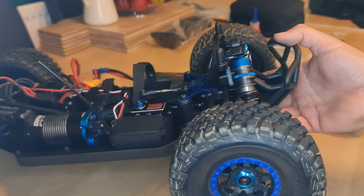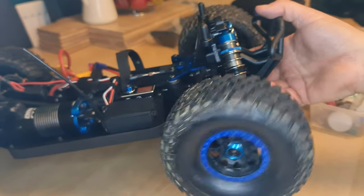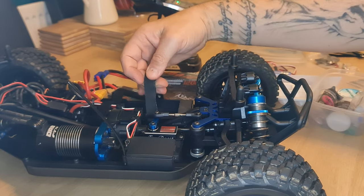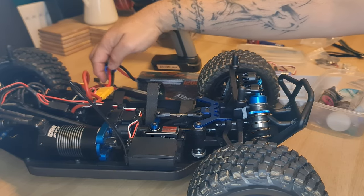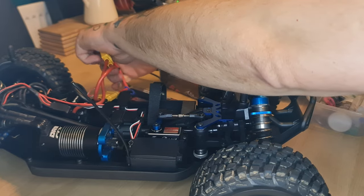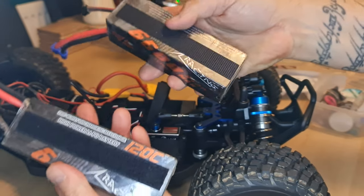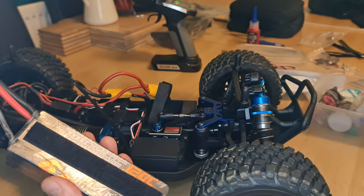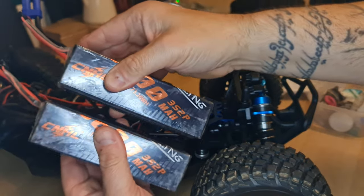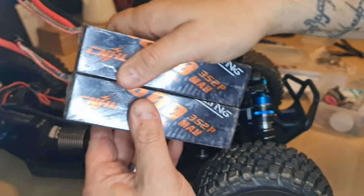Now we should have a fully working servo that's been upgraded — ten times better. As you can see, the JX range — really, really fond of. That's your servo all sorted. One thing I will say about the JX range: there is a little bit of servo chatter, but if you can deal with that like most can, no issues. Along with replacing the battery straps, what I've also done is added some Velcro on the bottom of the batteries — just to hold them in place when bashing. That will stop them moving about so much.